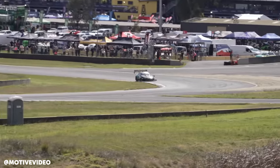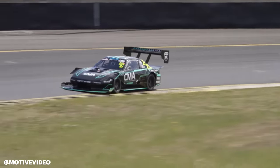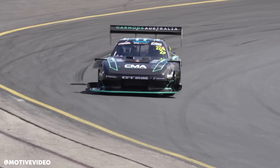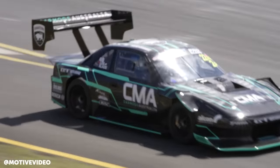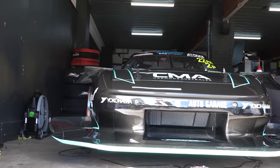A lot of people would not really be aware that these engines are making 1000-plus horsepower or thereabouts, and we see these numbers thrown around like they don't really mean too much. But getting that power reliably out of a 2 or 2.2 litre 4-cylinder engine, no matter what you're putting in it — billet block or not — it's hard work. You can have everything under the sun but you're on the edge of a 4-cylinder; it's a lot of boost and everything's stressed. With the VR38 — now a 4.1 litre version — you've just got more capacity, you're making that power with much less boost and much less stress on the engine. Yeah, we run 28lbs max.